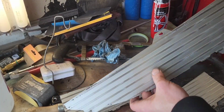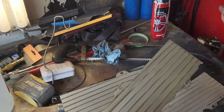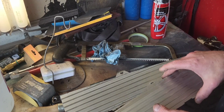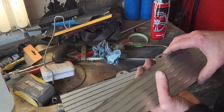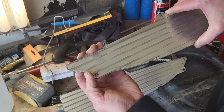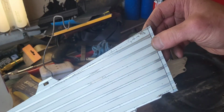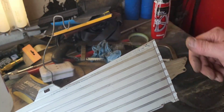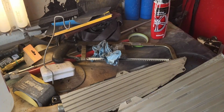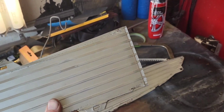So this is the original piece to the car that goes on the passenger side back door. And I'll show you really what you need to cut off of the piece you have left over from your quarter panel. So we'll get these all lined up. Alright, see that end? Basically what you're cutting off is your door gap. That's the amount that's going to have to be cut off. So I'll get that marked and we'll cut that off.